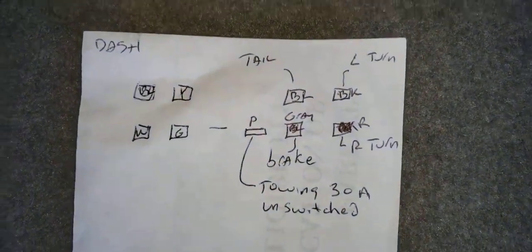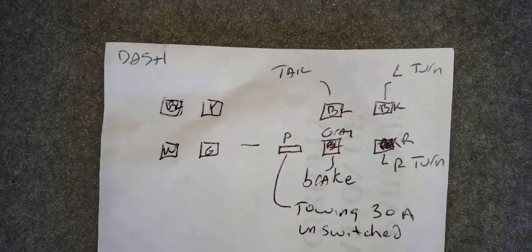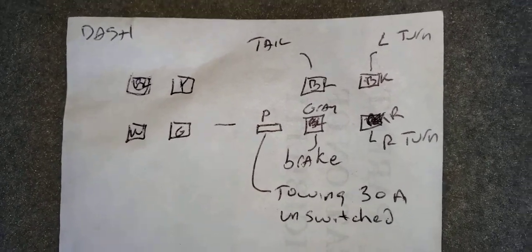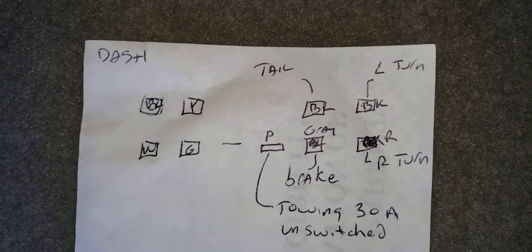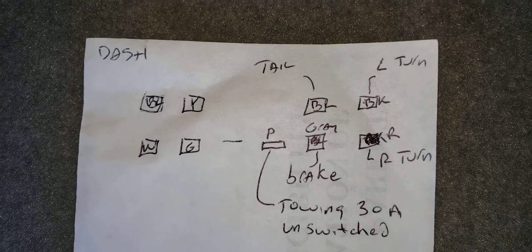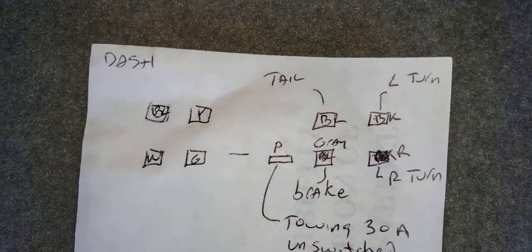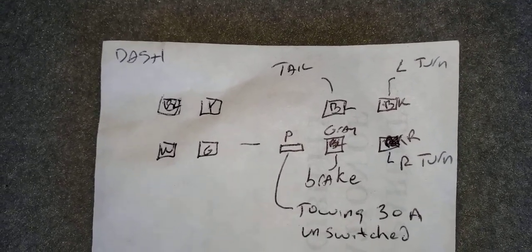So if you had to get some trailer down the road or something, you could jump out of this and just pull out the taillight or something and come out of this thing down here and then jump out again. Or you just run a wire, whatever. But you're going to have to buy the modulators. So here's what happens. Everything's separate between the turn signals and the brake. And that's why you need to buy the modulator, because it combines it and sets it up for an 1157 bulb, where in the 1157, the bright filament is the brake and the turn. And this is totally separate. So with this, if you put the turn signal on, you step on the brake, it's all separate. It doesn't change anything. So you need something that homogenizes it and links it together. And that's why you have to buy the kit.